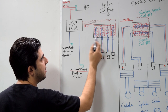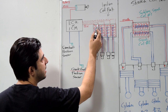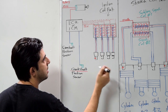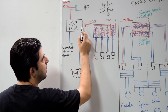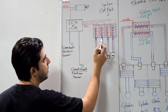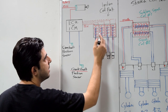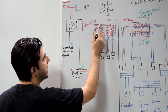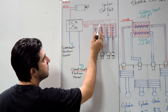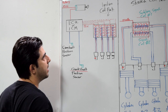At the end of each primary circuit, a wire comes out of your ignition coil pack and runs back to your ECU — that is the switching wire. So you would have one wire supplying 12 volts to the primary circuits, and then one extra wire per ignition coil as the signal wire running back from your coil pack to your ECU. On a setup like this, that gives you one plus four signal wires — a five-wire connector going into the coil pack.